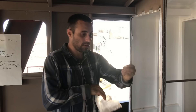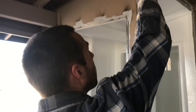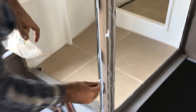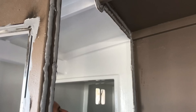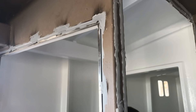I'm going to go through and put these little tile spacer things in - we want to make sure that the board doesn't go hard up against the steel and squeeze all of the sealant out. I just get these and literally just squeeze them in with some sealant as a glue like that. That way I know it's going to be at least 5mm out. If you hang them over the edge you can pull them out really easily later on. This is pretty much exactly the same technique that we use when we put the windows on - the windows on Brew Peg are bonded on with a window sealant that's designed to hold on to glass and bonds straight on to the primed steel.